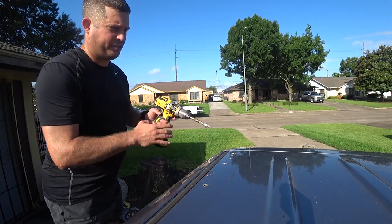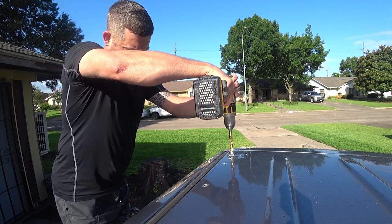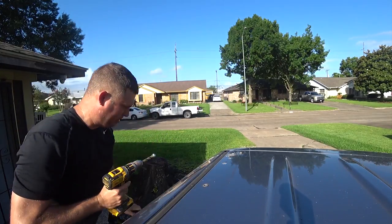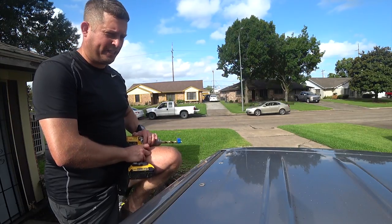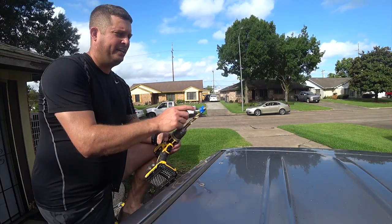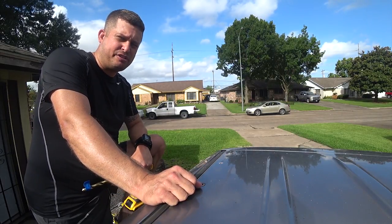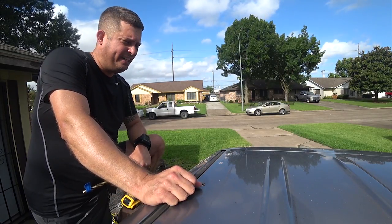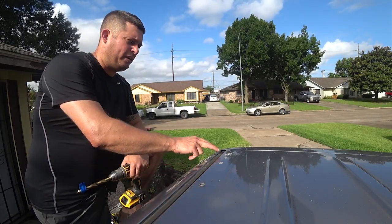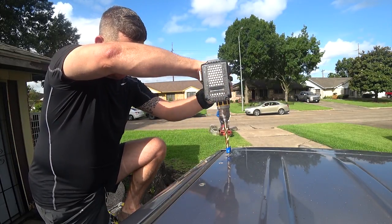I've drilled my quarter inch holes to start, and now I'm going to step up to half inch. But not with this drill bit because it's worn out. So I had to change the drill bit, and I'm using a cheap Harbor Freight drill bit, and the stop collars I bought from Harbor Freight have cheap set screws that strip out the first time you tighten them, so I couldn't get it back off. Which is a real shame because I bought it specifically for the half inch stop. So I'm going to use a tape flag, which is poor man's stop. Just be real careful.